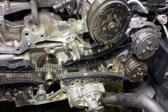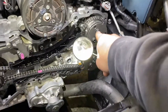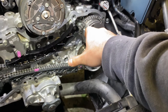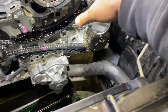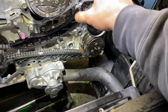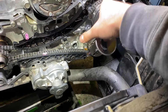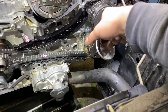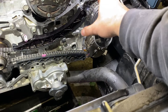We had an issue after the job, so this is actually the second time we've taken it apart. One of the new intake sprockets was sticking. When driving, it would get stuck at a certain degree — we could see this on our Autel scanner, which lets you access those readings. As soon as you'd start the car it would stick and immediately set a code. If it didn't stick and the duty cycle commanded a timing adjustment, it worked perfectly with full power and no issues. But the moment it stuck after startup, a code would set immediately.